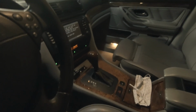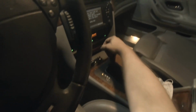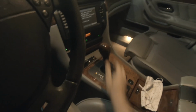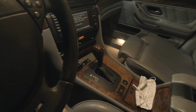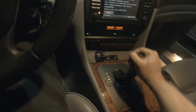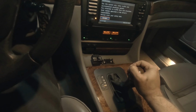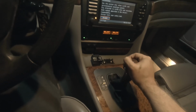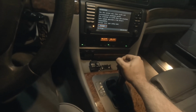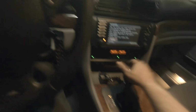All right. Okay, pull it into reverse. Oh, it's not gonna let me. I may have to have my foot on the brake, so give me 1 second here. Here we go, reverse. Pull that fluid up, neutral, pull that fluid up, drive, pull that fluid up, neutral, reverse, back into park. Okay, now I need to leave it running and get back underneath the car and put some new fluid in.